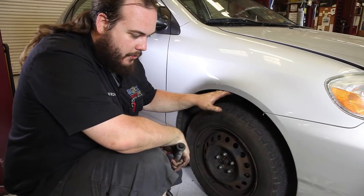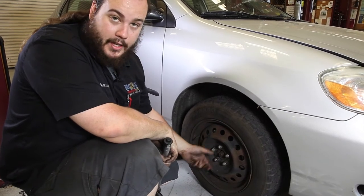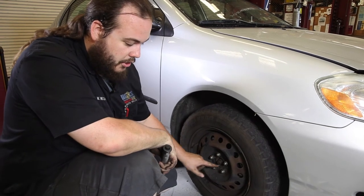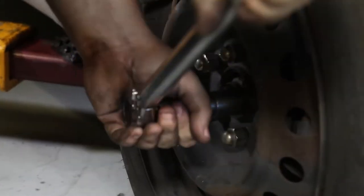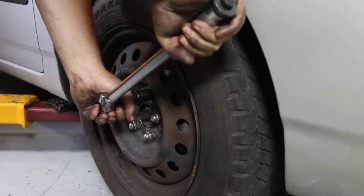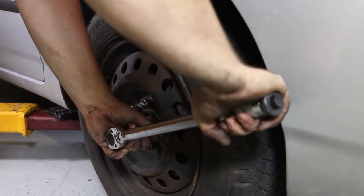As illustrated before, it's 76 foot-pounds. We're going to torque these wheels down under their own weight in a star pattern. Some vehicles have four lugs, some five, some six, some eight — just make sure you do a crisscross pattern to equal out the torquing across the wheel. With this torque wrench, you do it until you hear that click, then move to the next one.